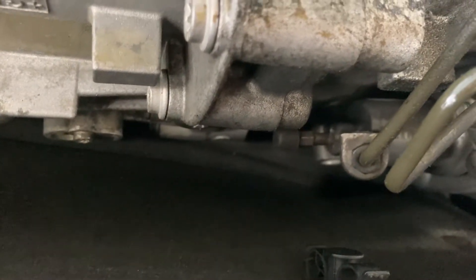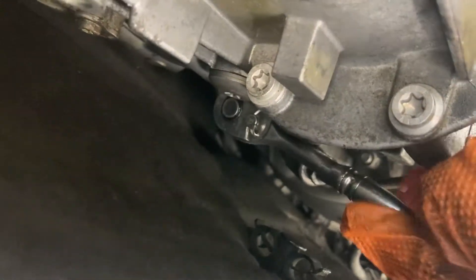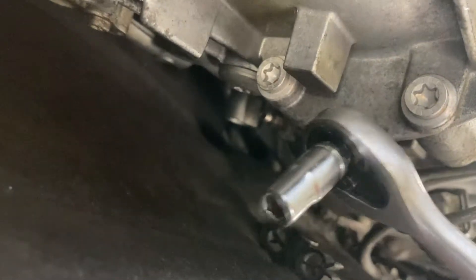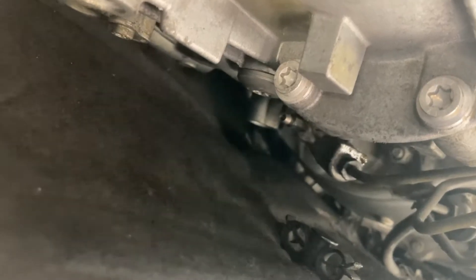For those that have a proper car — don't forget to bleed the slave cylinder. The slave cylinder is a seven millimeter. I didn't have a seven millimeter combination wrench so I just used a quarter inch with the seven millimeter socket. A little brake fluid came out but it was no big deal, and we're all done under here.